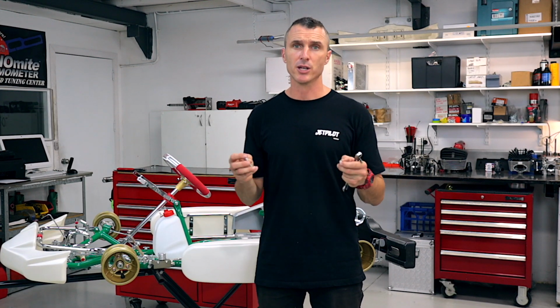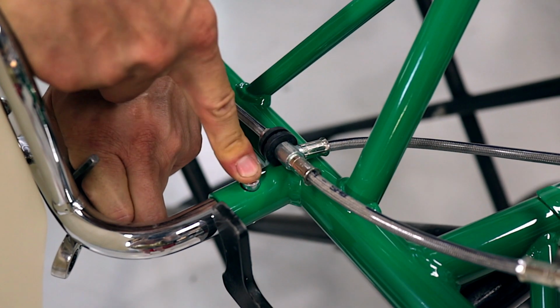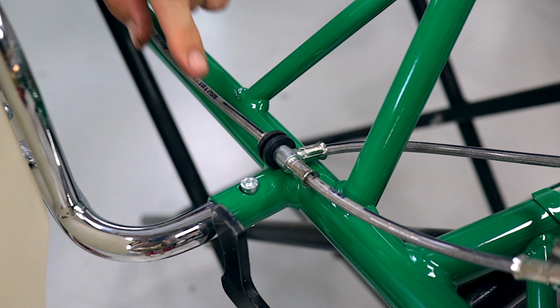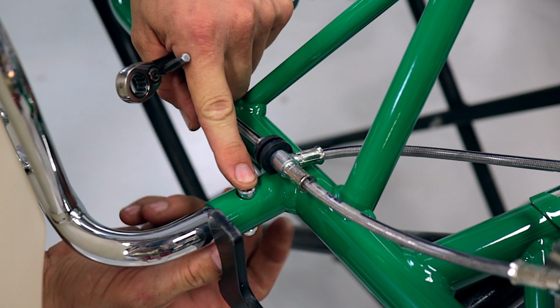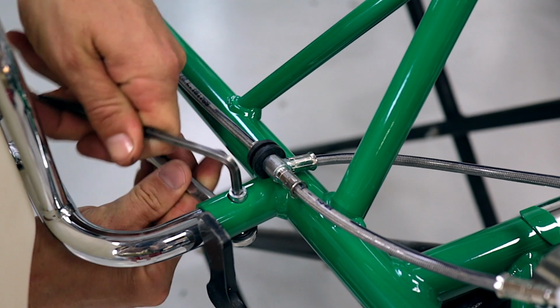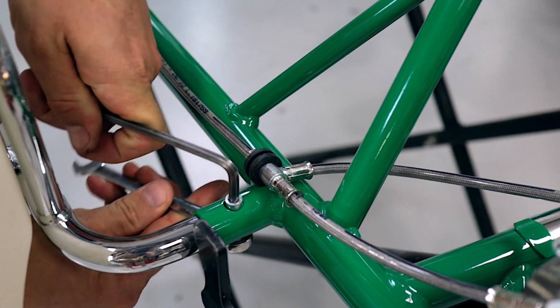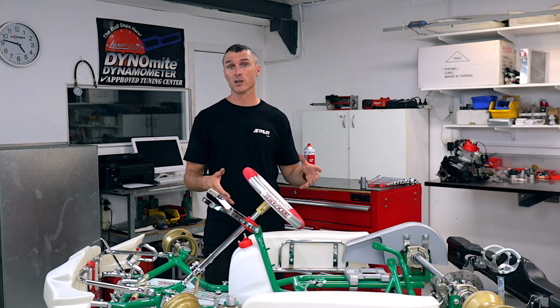By trimming down the red pin and removing the flashing off the anti-vibration bush, it stops the excessive stretching of the bush and it stops it from splitting as well. Lastly, install your rear hardware and you're good to go. Now it's just a case of repeating the process on the other side.